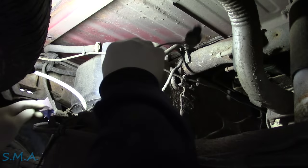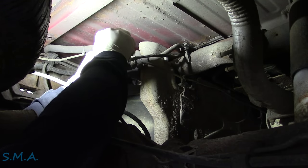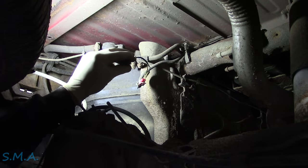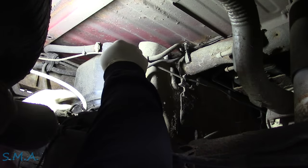It's just going to be your classic 194 bulb. We're going to probe it in there. This is going to make sure our whole circuit can carry current, which it should. We'll turn it on — we can see it comes on. And then we turn it off. Super duper easy.